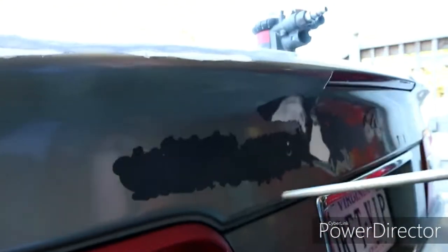It's really hard to see, but more paint is just flaking off as I blow this. That's wonderful. So that just says the paint didn't stick to this. Basically, that's the spoiler on the back of this. I'm going to have to really sand that whole spoiler down and get the paint off completely, because it's just flaking off like nothing. Well, oh well, that's just more work.